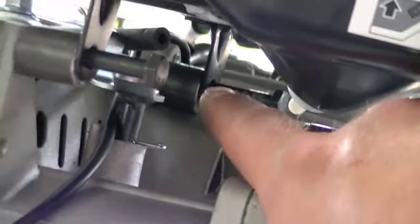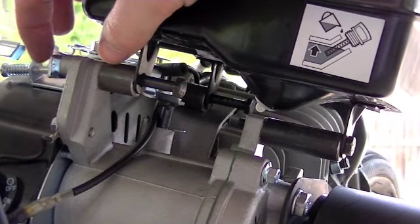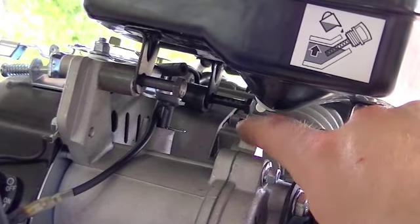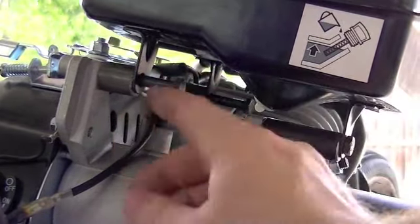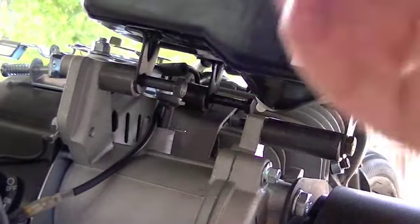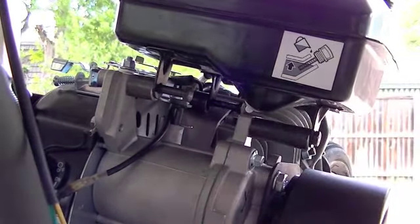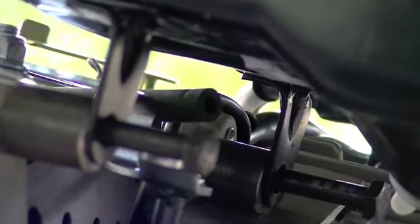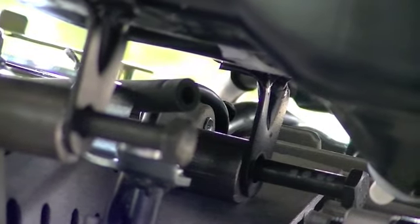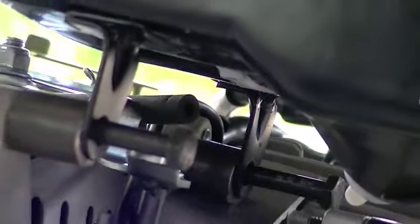That's how I've got it mounted to the engine — I just utilized the original mounting holes. These holes are drilled and tapped all the way through, and these are the original tank mounting brackets. I got three bolts all the same length but only one of them worked out, so obviously these are too long and I'll go back and get some shorter ones. But that's the basic idea. I also have to get a longer fuel line — you can see that little tube right there. I'll probably get a small inline fuel filter too, even though this tank has a little filter inside.